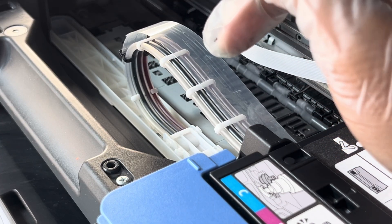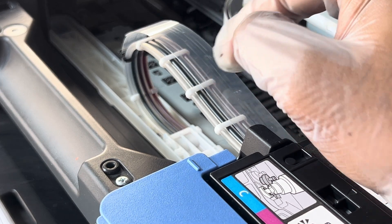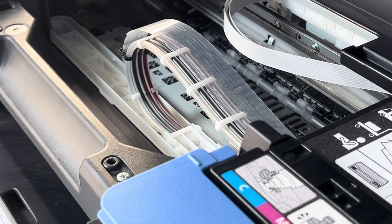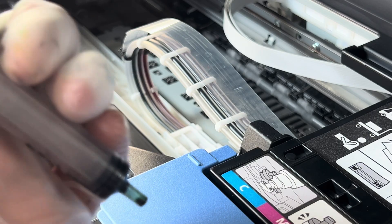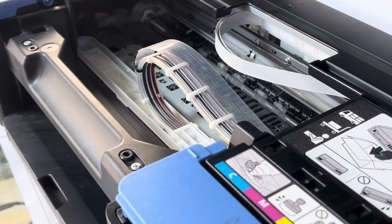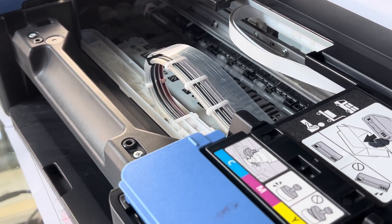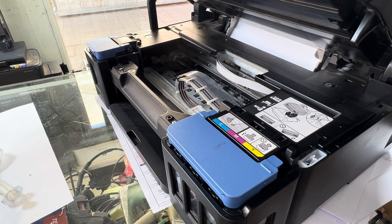For the sake of argument, if you didn't succeed in printing any of the colors, you have to do the same thing mentioned just a while ago — remove the print heads and one more time use a syringe to press with air and unclog it. If you have any other question regarding any Canon printer or any printer, you can ask down in the comments. Thank you for watching.